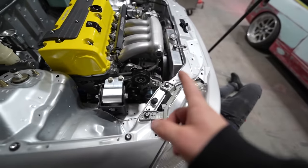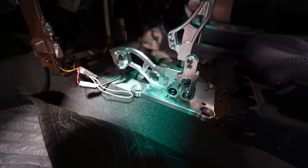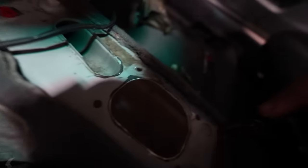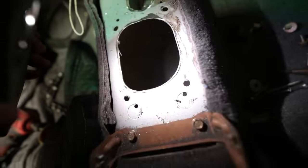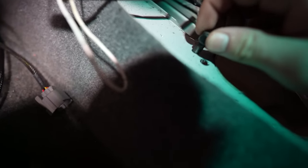Putting in the power steering pump, but there seems to be some complications. K-Tune said they haven't tried this on a right-hand drive car, and it seems we're having an issue with it hitting the radiator. For me to fit the shifter in here, this lip right here — I have to grind it down so it fits flat to the transmission tunnel. I gotta smooth this down a little bit. Alright, so grinded it down — this now fits nice and flat. Have to make new holes, get hardware, put it through, and mount it.